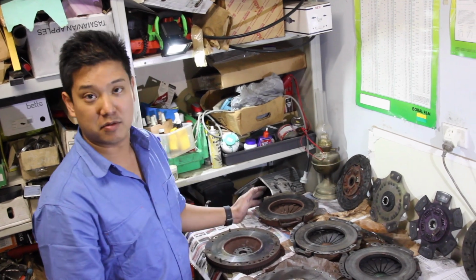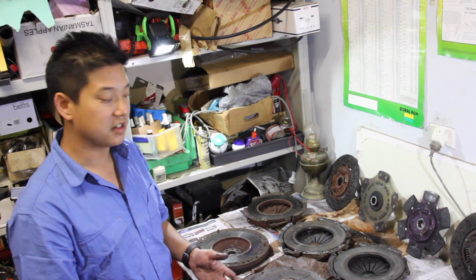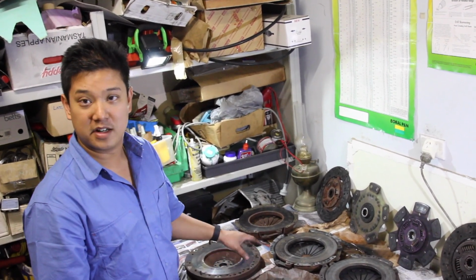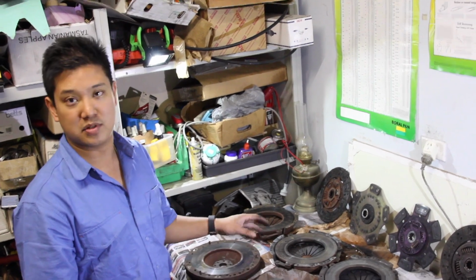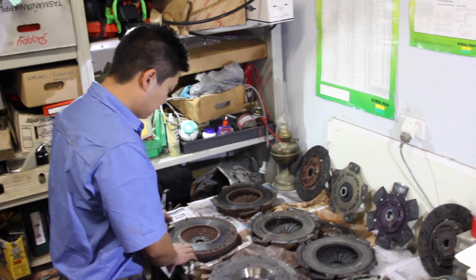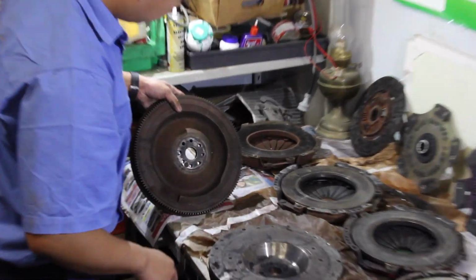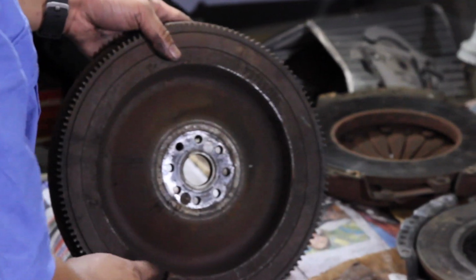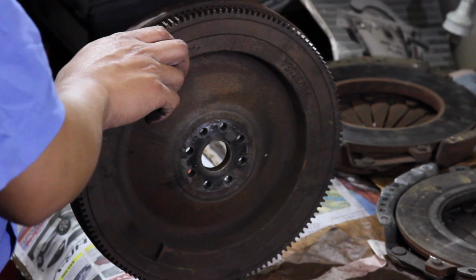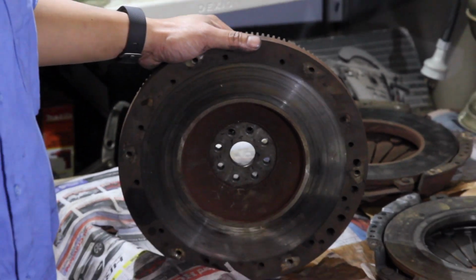And that was great for quite a while when the engine just had rockers and a small boost upgrade and so on. It was a great daily, and it's lasted all the way through to now where I've got a camshaft, boost, E85 and so on. This is the Buick flywheel, standard cast. There's the GM part number on the back and the standard Buick counterbalance weight. I sent it off to be match balanced to the flex plate.